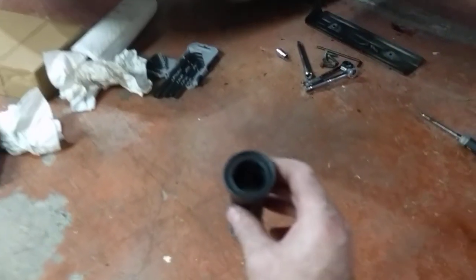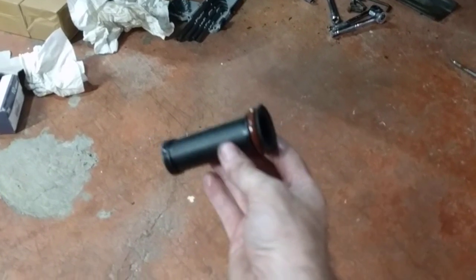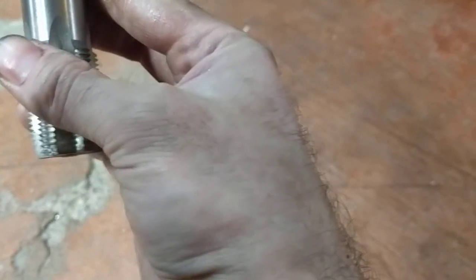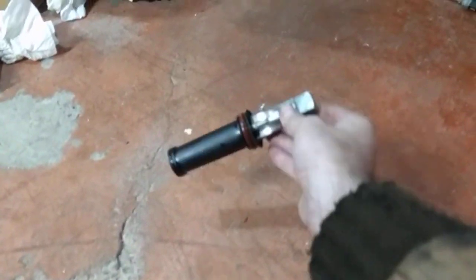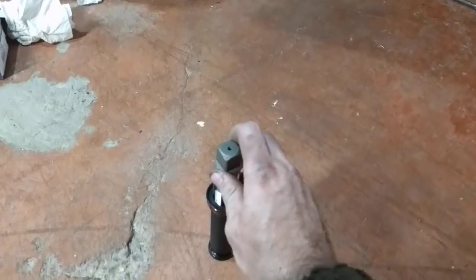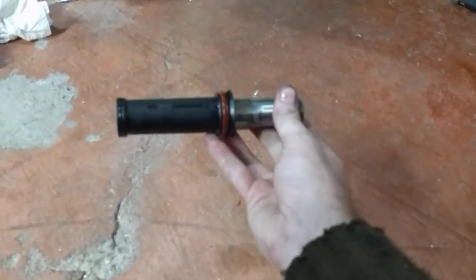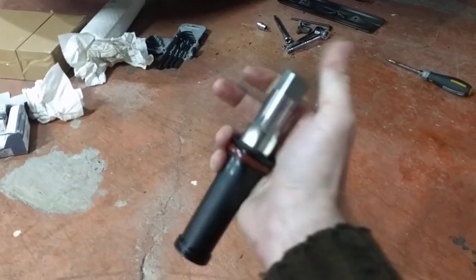If you need to get these things out, they are stiff beyond belief — you won't be able to get them out. What I did was take a three-quarter inch pipe tap and jam it in there. That's the secret trick. If you don't want to buy the special Porsche tool, jam a pipe tap in there and just pop it out with a screwdriver.